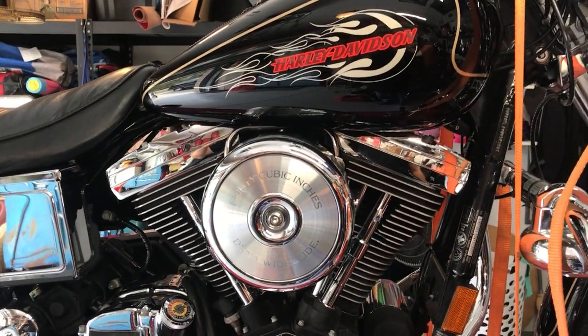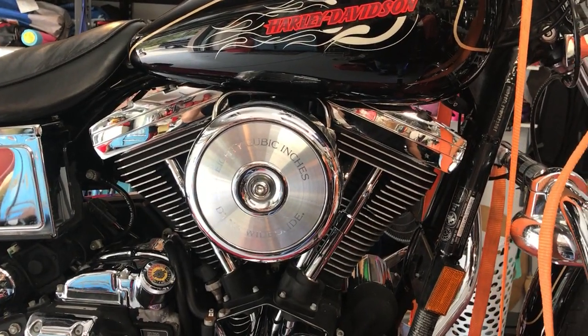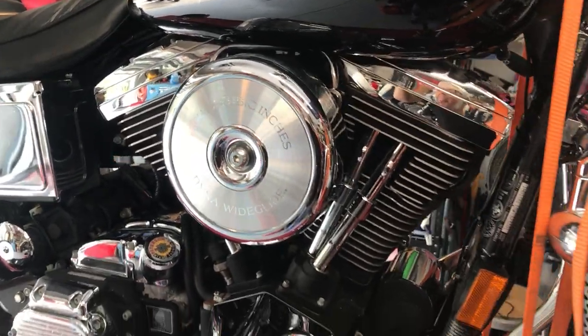Welcome to Fitch Painter Repair's Garage. We're continuing on the 1998 Dyna Wide Glide. We did a carburetor rebuild — this was originally a no-start, crank but no start. We've done carburetor and intake manifold gaskets, re-jetting, and cleaning out all the stuff in the fuel tank.